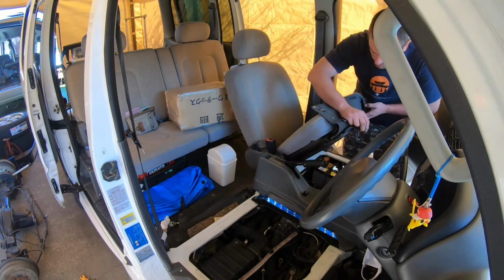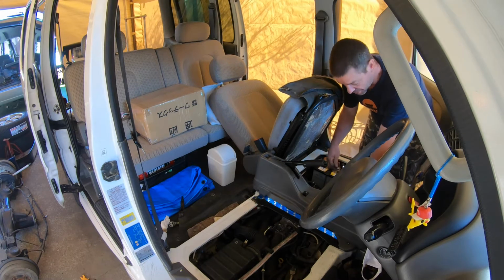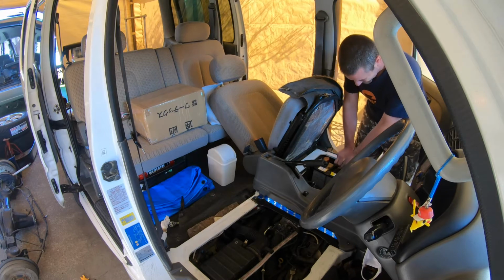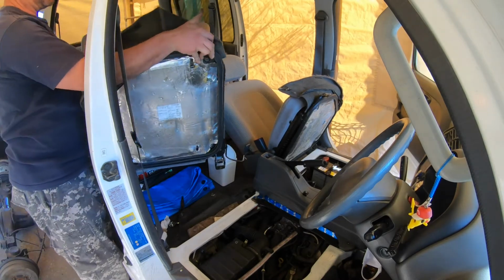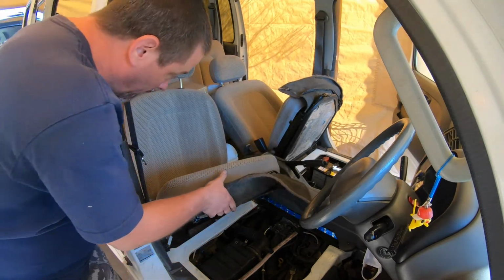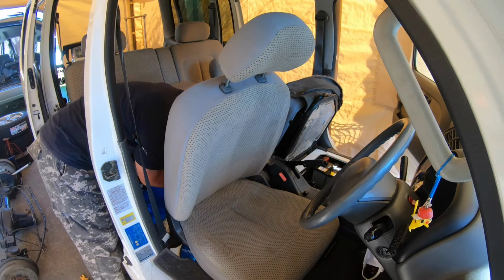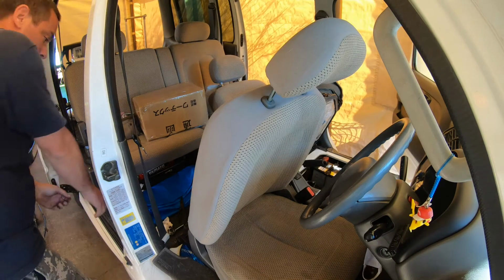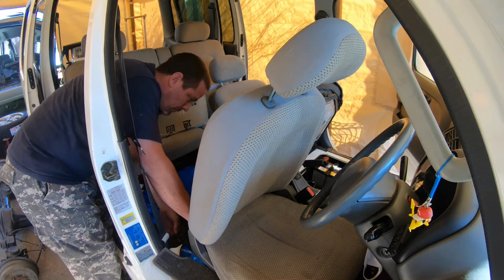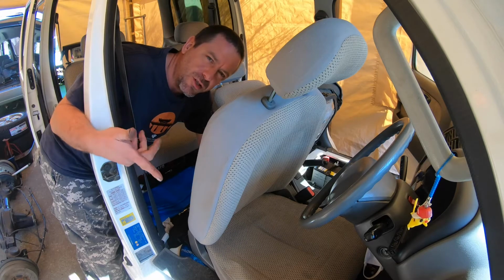Seat back. Remember, disconnect your negative terminal, not your positive one. Why? Because you can't short it. You don't have to put the seat in that way, I just find it easier. For those playing at home, the seat bolts are a 14. Don't forget to put the carpet in before you bolt the chair in, because for some reason the carpet goes in first.